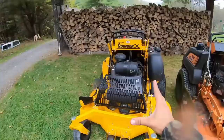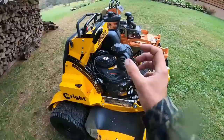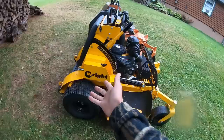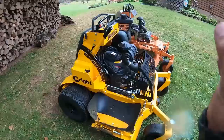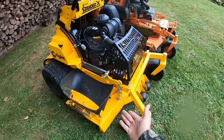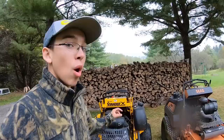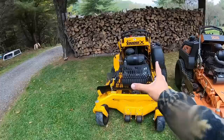When I'm riding over bumps that normally just move the deck a little, it also jolts the engine up and down and actually causes it to cut out — the same as when you step off the platform with the safety switch while the blades are engaged. Just imagine that happening while you're mowing. I've heard people have this with other Wright mowers. With a carbureted engine — and both mowers have the exact same engine — it definitely cuts in and out, and I don't know how good that is for engine health.